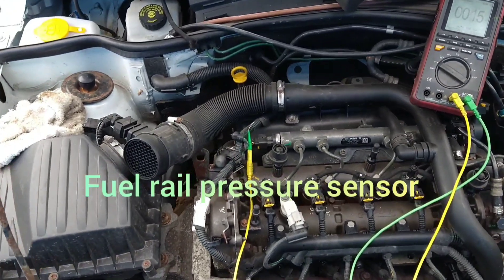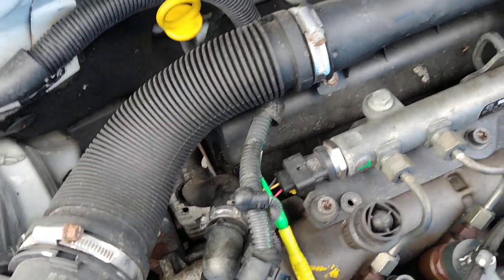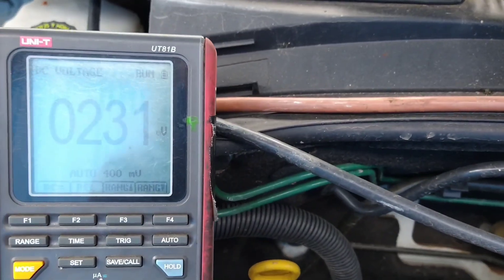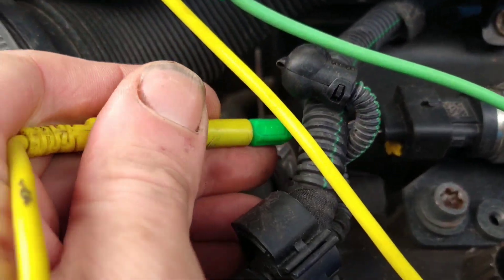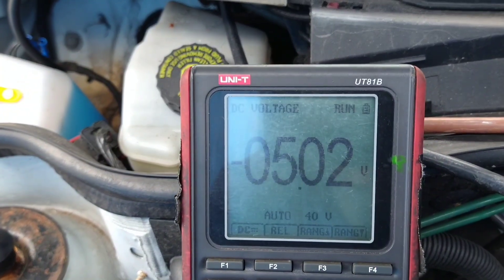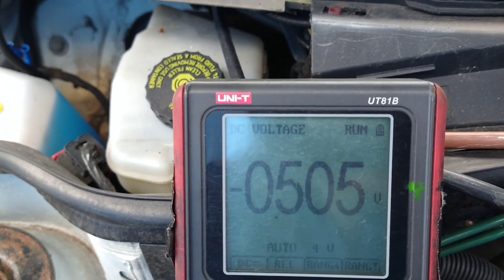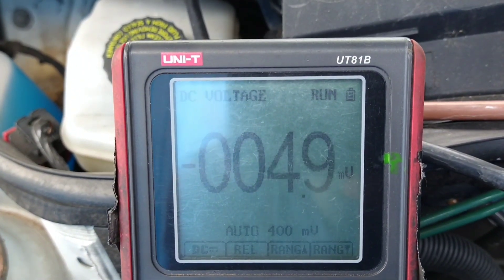What I'm going to do is check the sensor because it's showing zero for fuel rail pressure. Here's the fuel rail pressure sensor — three wires. One side of the multimeter connected to the battery negative. We're going into the first wire, the red wire. Five volts. So now we're going to check the other one — the center one. Sometimes, not always, it's the signal. 0.5 volts. So that's looking like it's working. 0.5 — so we've got no fuel. That's the ground.